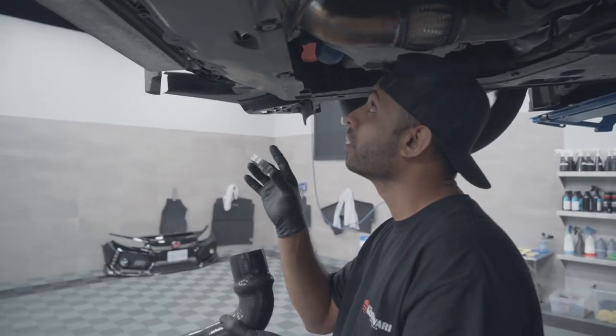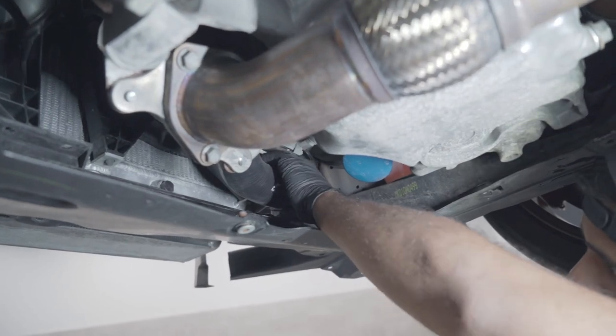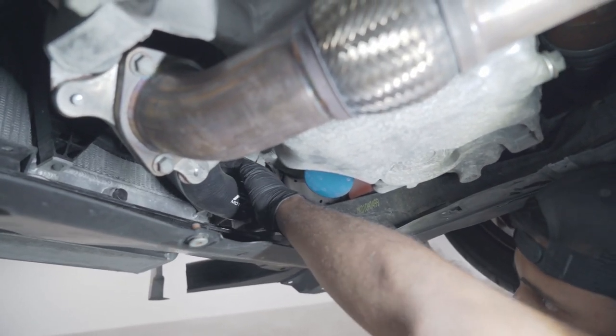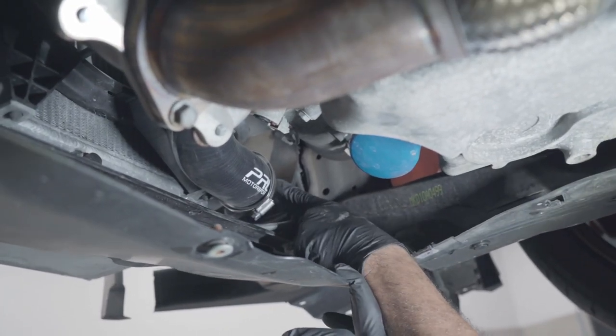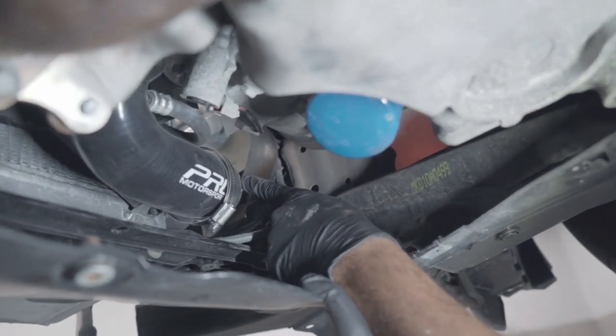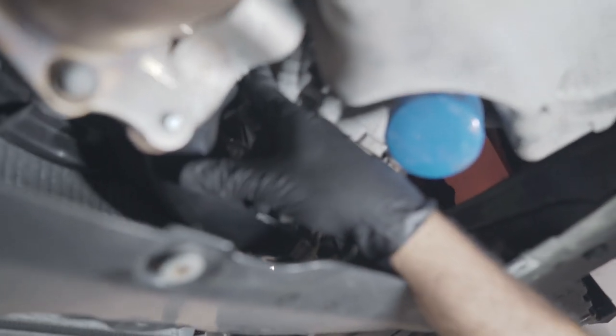Don't fight your clamps — make your life easier. Put it in a place you can reach. You've got to move a little quickly when you have hairspray on it because it has a tendency to dry pretty quickly. On the pipe it's all the way up — that's where you want it to be. And then on the turbo it is all the way up as well.